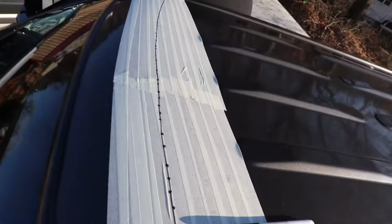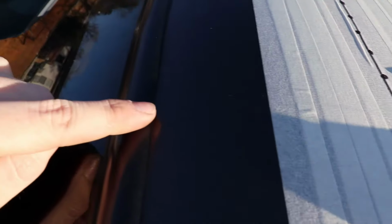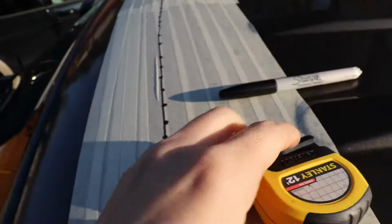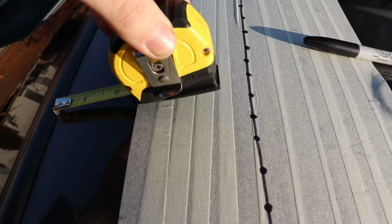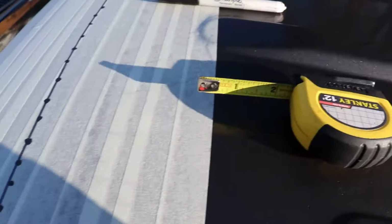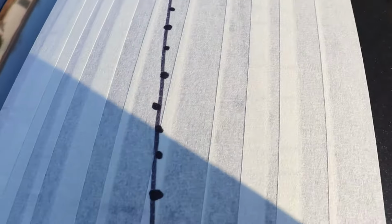And then you'll need some silicone or some sort of rubber sealant, you know, waterproofer for each hole and all of that stuff. So the way RECON wants you to do this is it's 5.5 inches from this rubber seal right here. You go 5.5 inches up. So pretty much all I've done, it's kind of hard to do with one hand, you just hold your ruler straight and go down to the rubber seal and go 5.5 inches up. And I just put all of these dots all the way across, and then ran a line through all of those dots that are 5.5 inches.